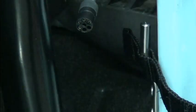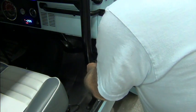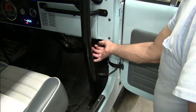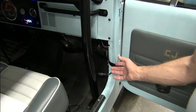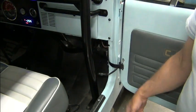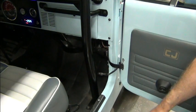That caught my attention, so I went over to the driver's side to check. Since the driver's side has switches for both windows, it would make sense for it to have four pins — and sure enough it does. It looks like they have the wiring harness reversed: this side should be going to the driver's and the other side should be going to the passenger. I'm going to look at how involved it is to get that loose.